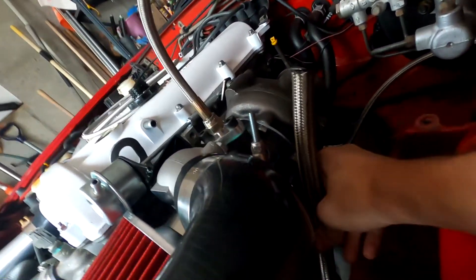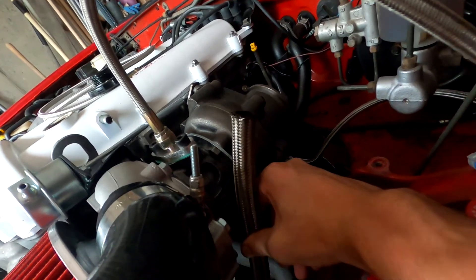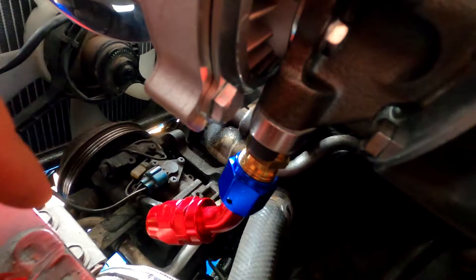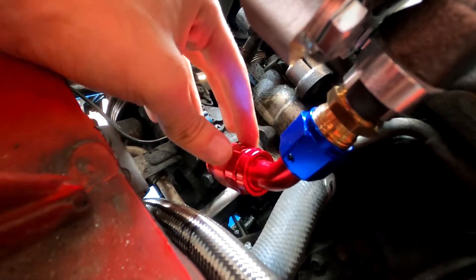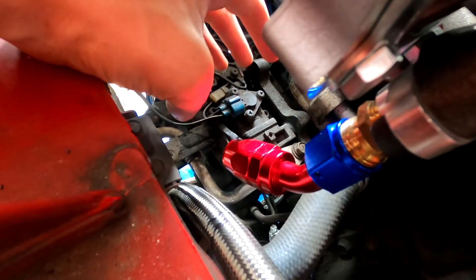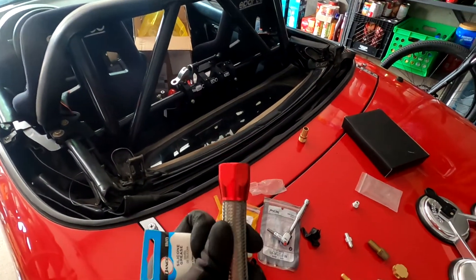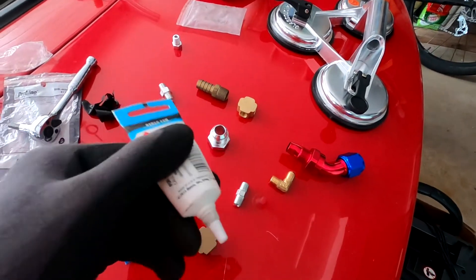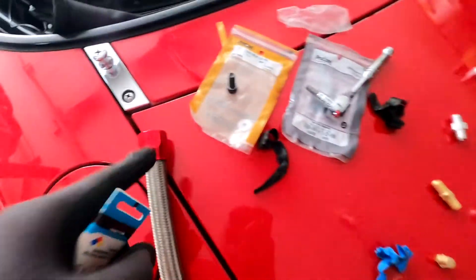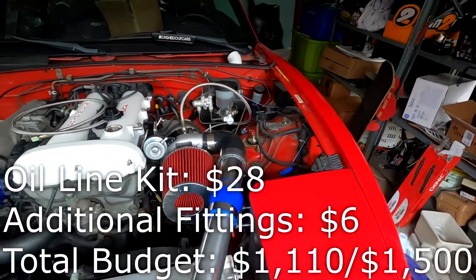Now I'm going to go up top and take a look at where I want to trim this thing. This goes right to the bottom of that turbine housing, so it looks like I could take a couple of inches off — maybe about four inches — that'll give me a little bit of wiggle room. I've got this fitting on the turbo and marked where I need to cut this braided line in order to make this thing fit. It's going to work pretty well having this angle up here because it kicks the line forward, which gives me some clearance around the rest of the stuff. Now that's cut and this end of the fitting is screwed on — I'm going to use just a tiny bit of silicone on there to help the thing squeeze on nicely. Now that line is all hooked up, I just tightened down the top and bottom fitting, which means our oil lines are all set.